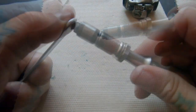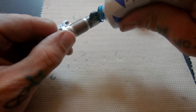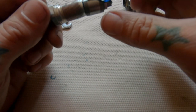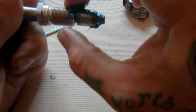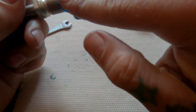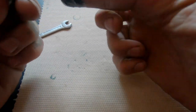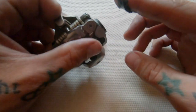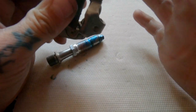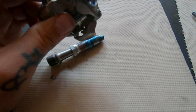Reinstall the little locking nut and tighten the two against each other, trying not to tighten the preload nut further as you don't want the bearings overly tight. I like to add a bunch of marine grease to the spindle once everything's cleaned and greased internally — put a whole bunch on the outside, and a bunch of grease on the inside of the pedal body. Jam them together; there will be some excess grease wasted, but with no room for water in there, your rebuild job should last hopefully a whole season.